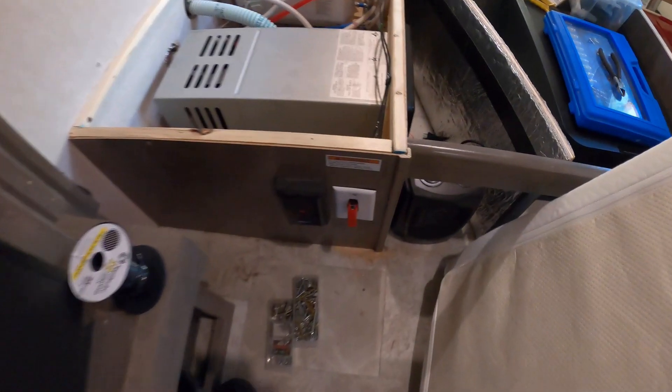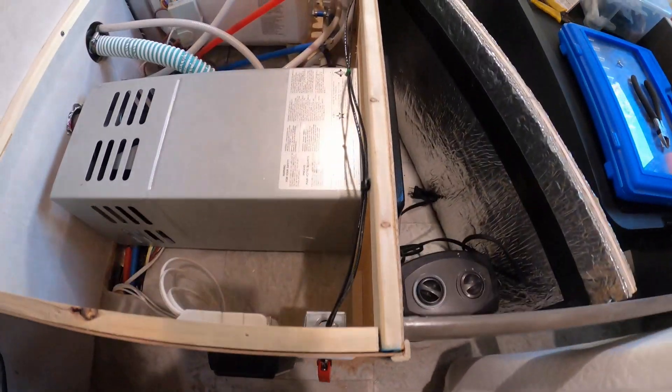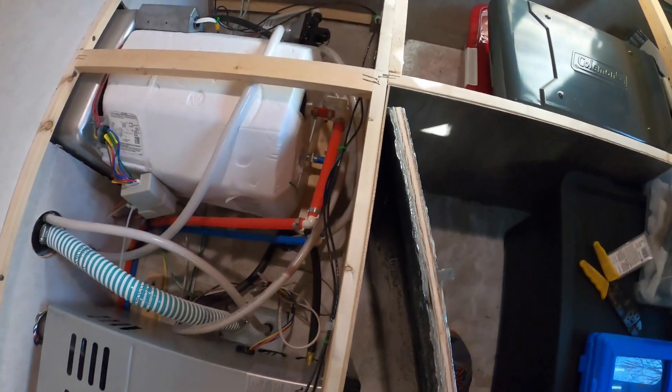This is a before picture. We sleep with our heads on the starboard side of the r-pod, so we're going to add an outlet on that side. I'm going to attempt to tap power off the nearest AC outlet to this location. Fortunately, in the r-pod model 180, the nearest outlet happens to be wired from the cargo area under the bed, so running a wire to the new outlet location should be pretty straightforward.